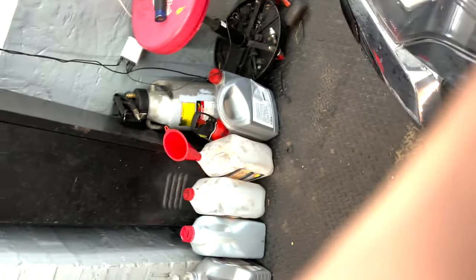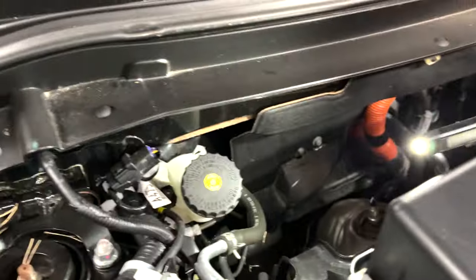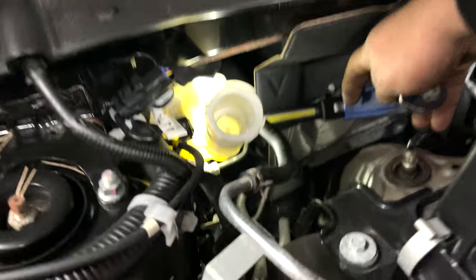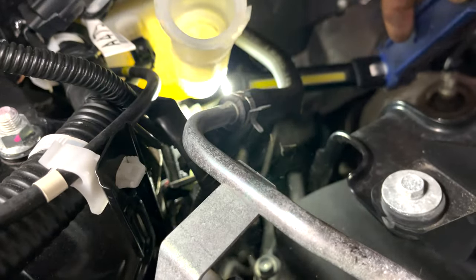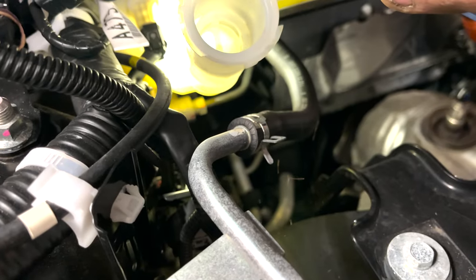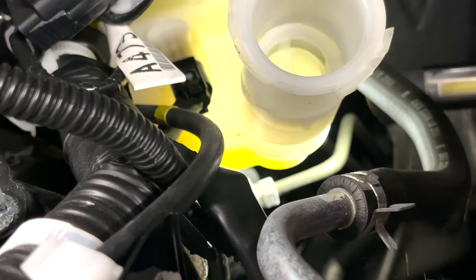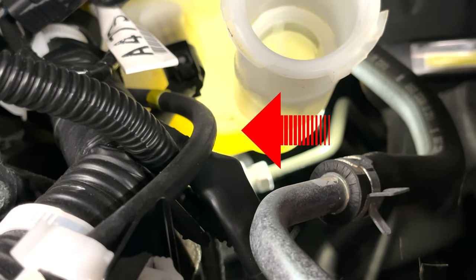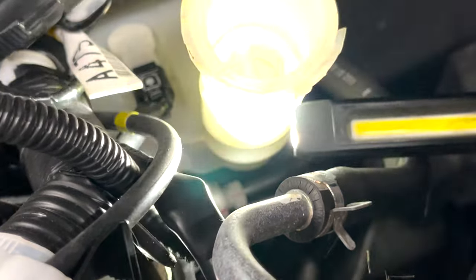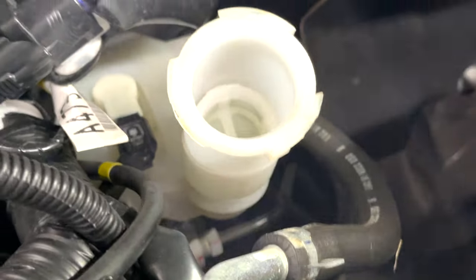Just open the bonnet there. So obviously when I do the pads I tend to check the brake fluid. I remove the brake fluid reservoir cap and I can see the level - I don't know if you can see very well there - but it's very low. Is that the minimum mark or lower? You guys are probably not going to be able to see it clearly, but it's at the minimum mark or lower. So I'm going to just top it up a little bit, leave it in the middle because the max line is at the top and the minimum line is down there.